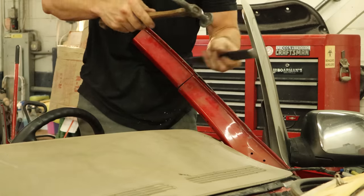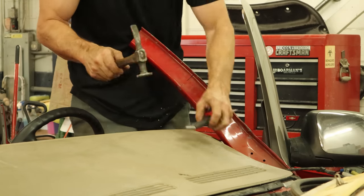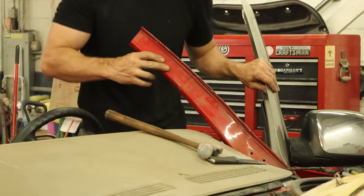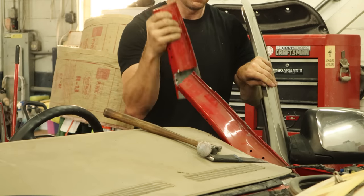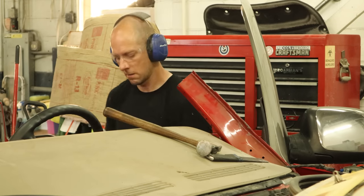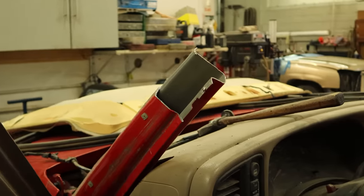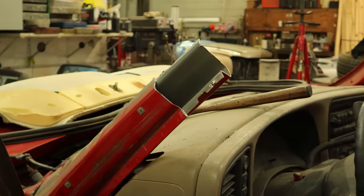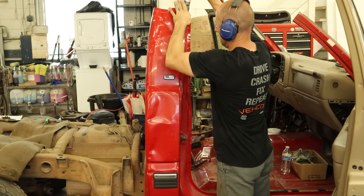So we drilled all our spot welds — there's like three of them in there in between the two cuts. So we're going to hammer those out, wiggle the ones that didn't want to give up. We're not going to toss this in the pile just yet. Here's a better look at our A-pillar with our staggered cuts, the spot welds drilled off. Now all we need to do is throw our backings in there and we're ready to put it together.